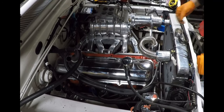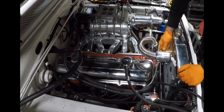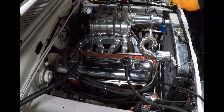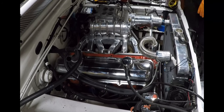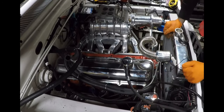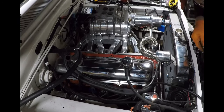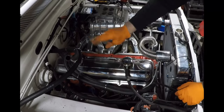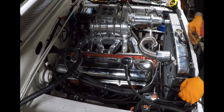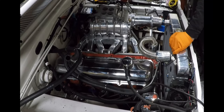We're going to pull the radiator. First thing I'm going to do is disconnect my thermal sensor — this is just for the electric fan, works great at 180. I'm well aware this looks junky; I'll clean it up. The point of this is shade-tree mechanics, backyard job. For the moment we're going to leave the heater hoses alone because I've got new heater hoses coming. For this I think all we really need to do is take off the fittings on the bottom — are they 9/16ths or 5/8ths?